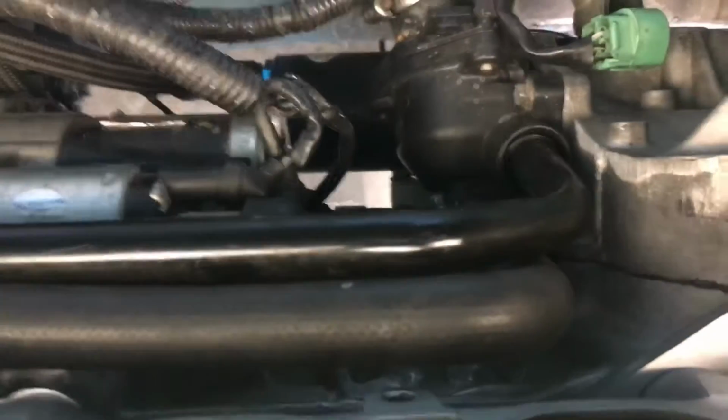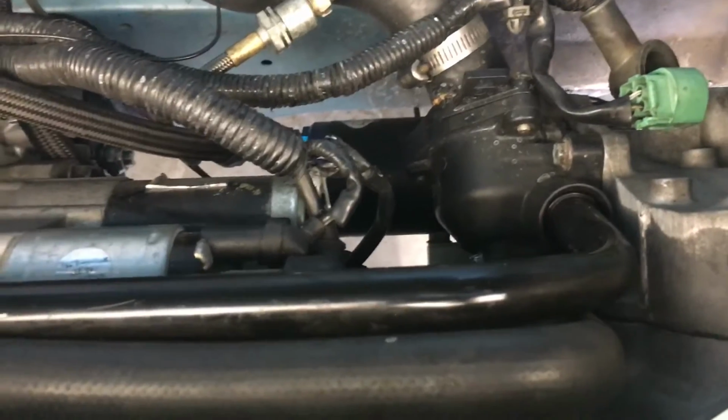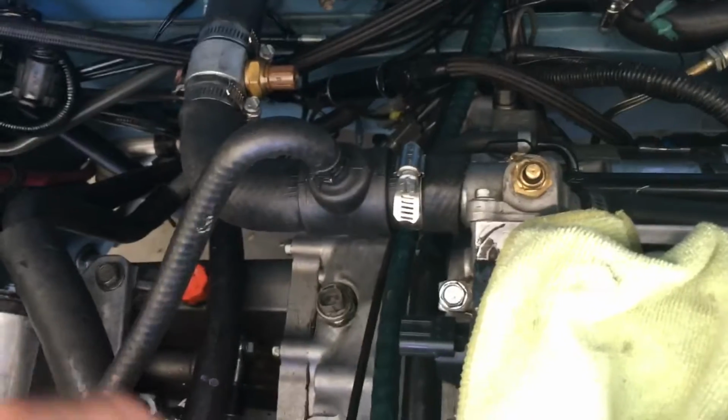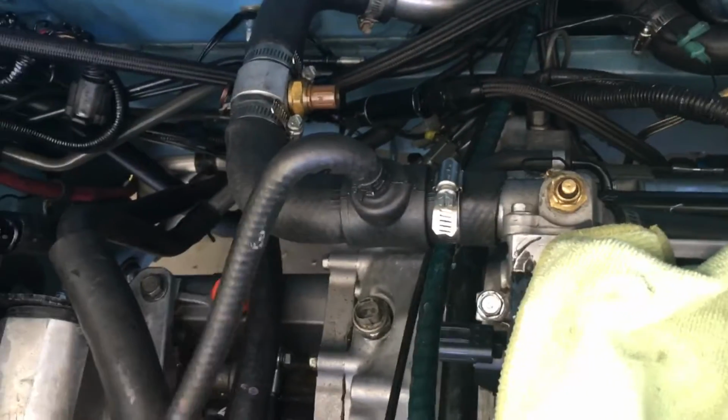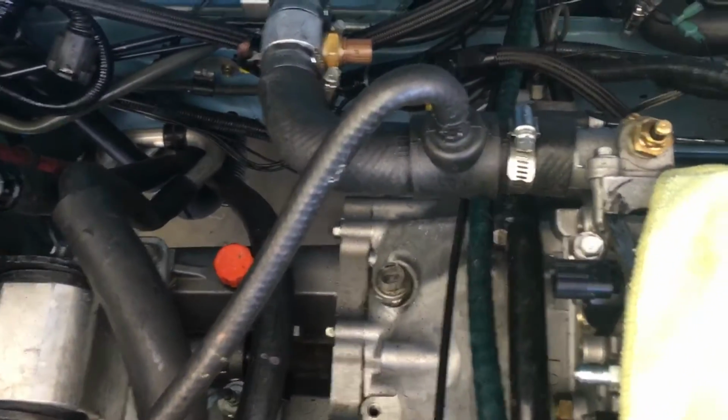Also, where you fill the car at matters. So you want the bottom of your tank going to that heater hose, okay, which goes down to the thermostat housing. So when the car's cold, it'll fill up with water, no problem. Obviously the thermostat's not open if you're filling it with water. And then the top hose goes to the top radiator hose, so you can get all the air out of the system. That's really it. I don't really know how else somebody could get it mixed up if they're not running this bypass hose or something like that.